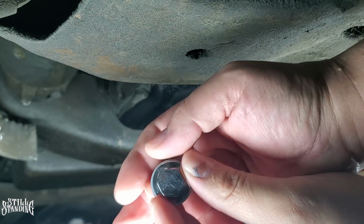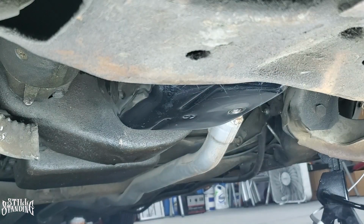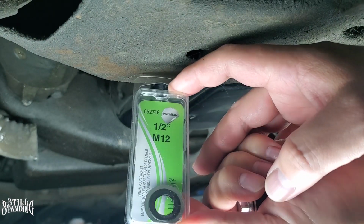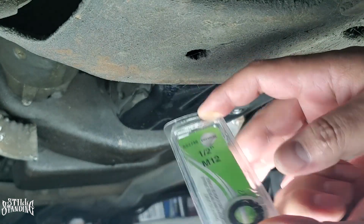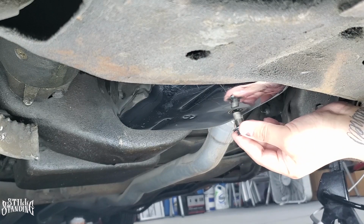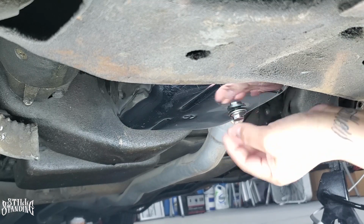Let me see if it'll focus. Cleaned up the bolt and I put a new washer, or new drain plug gasket, here. They're pretty cheap, about $3 for the set of two. Here's the part number for these little V6s. It's the 652746. I'll put the link in the description so you guys can check that out if you need them. I mean, they're pretty cheap, so why not replace them every time you change the oil? Prevent those leaks. So pop this one in, tighten it up, and then we'll move on to the oil filter.